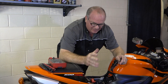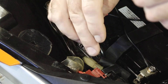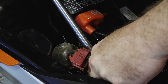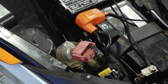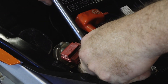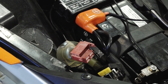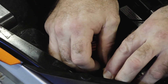But let's say you did that and it still didn't turn over. The next thing we want to look at is to see if this relay is actually functioning or not — and you're actually just listening to it. To do that, I'm disconnecting the starter cable; otherwise it'll just fire right up and you won't be able to hear what I'm talking about. So we're just going to temporarily disconnect this.